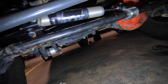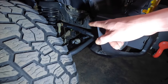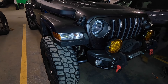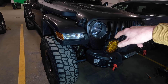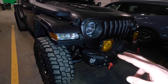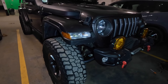I'm going to pick up this bracket for myself and throw one on my Gladiator. I'm also happy we got those bushings in the easy way with the ball joint press, so when I have to do it on mine I won't have an issue. Once we do our lift I'll look at doing the bushings at the same time, because as Sean mentioned those are the only things that start binding once you have a lift — the flex in those stock bushings doesn't match what comes with upgraded control arms.